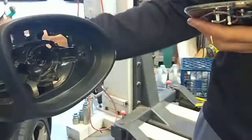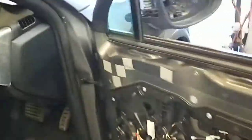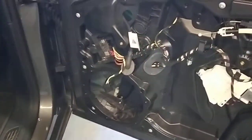If the plug was still there on the original harness, I wouldn't have had to do that job. But because the harness was broken and ripped off, I had to run it properly. Otherwise you'll get alarms and faults in the system — and if the wiring is too short, the pins can touch each other, short out, and blow the computer, which would be very expensive. Thanks for watching, please subscribe.